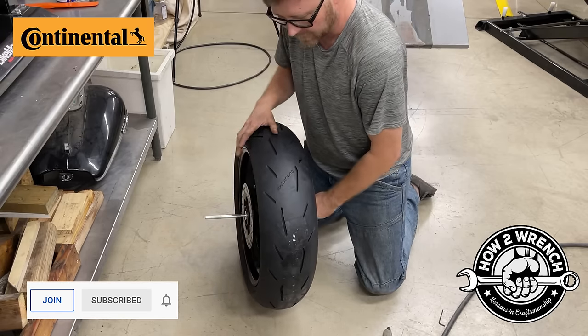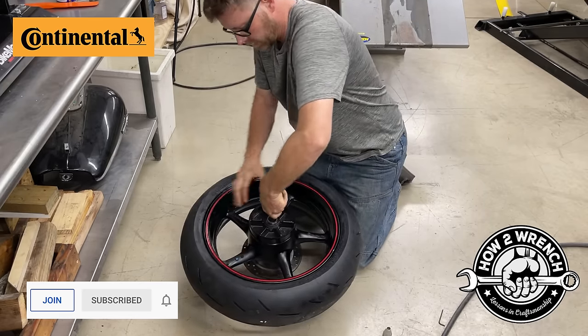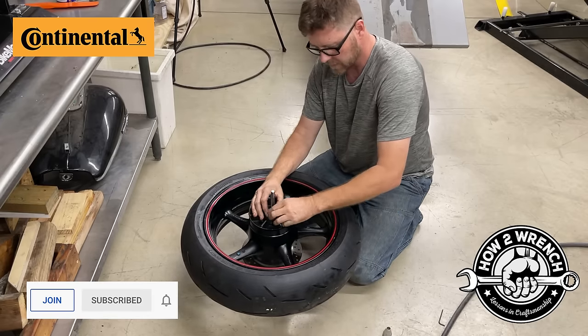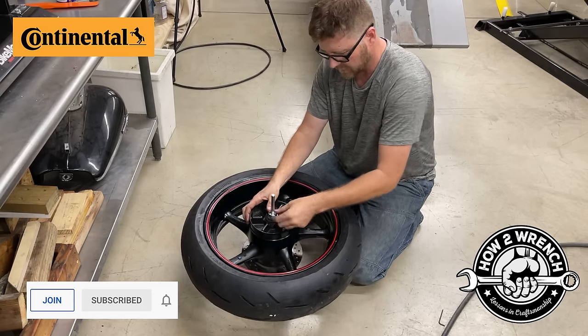But here's the thing that makes all the difference and why I feel like this will save you a lot of trouble. Mount these. Let's go ahead and put the weight on that, okay, because what we're doing is we want these cones to tighten up. And you're going to see here on this one, there's actually a needle bearing under here, so I have the inner race in there. And then go ahead and get that on there.